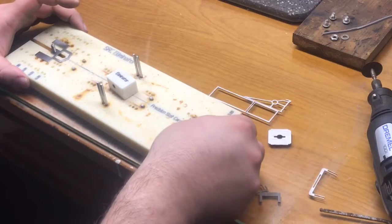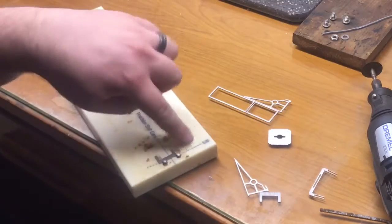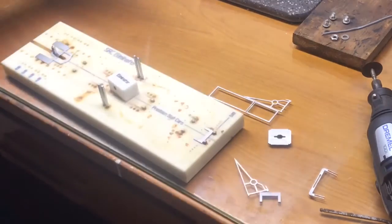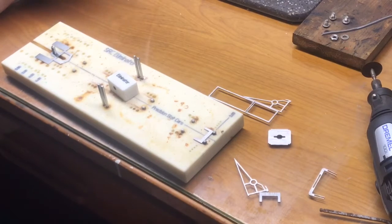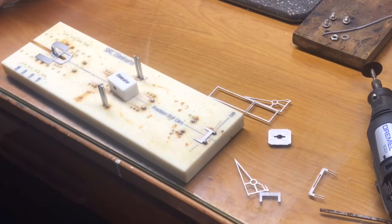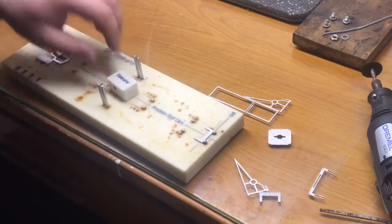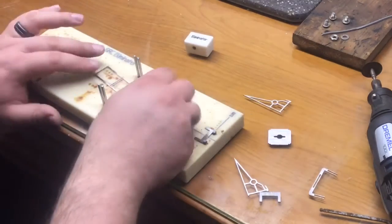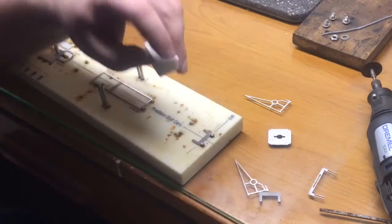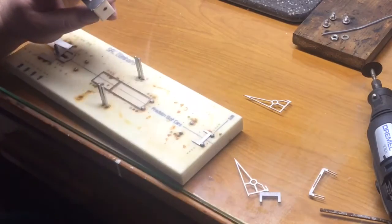You can kind of set your wheelie bar holder, I guess, wheelie bar bracket, and on the board it's right at 5 inches, which a lot of different classes require no longer than a 5-inch wheelie bar. If it's a bracket car, it can be as long as you want it to be. It doesn't really matter, but for actually competing in classes, that makes sure that your wheelie bar is to spec. So we'll go there. And the motor block really makes things a lot nicer to where you can actually just bolt it together right on there.